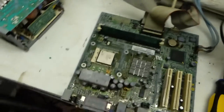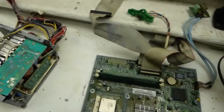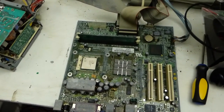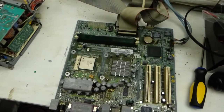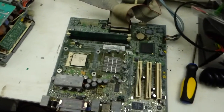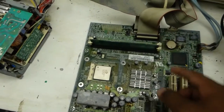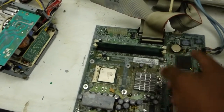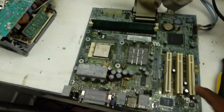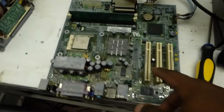I'm going to get rid of these ribbon cables altogether — well, I'll use one ribbon for the optical drive so I can upload the software onto it, then remove it. I'm not into the whole optical drive; everything for me is all downloadable. I'm going to be adding — I already have 256 megs of RAM, PC 2100 at 266 MHz — so I'm going to add another 256, giving it 512. For the video card, I'm going to put in a PCI video card at 256 megs.